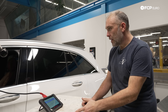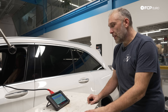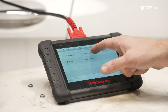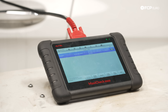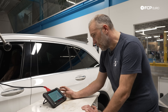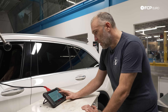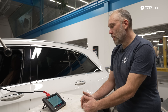I've plugged our Autel MX808 into this GLC 300 and there are faults on it. The one that stands out immediately is the powertrain control unit — one fault. We have a P026E71 active and stored fault code, which says actuation of the coolant pump of the charge air cooler has a malfunction — the actuator is blocked. The commanded actuation of the low temperature circuit circulation pump 1 is at 100%, meaning there was a very high demand for cooling.